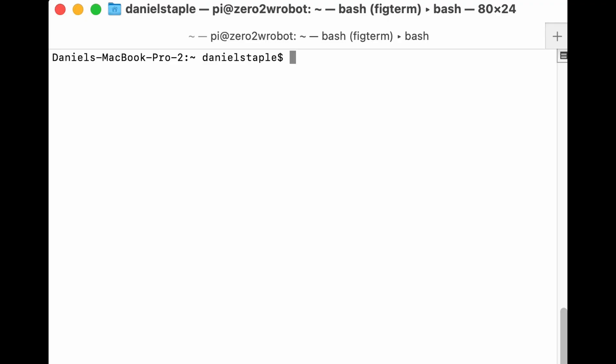You shouldn't need to do this, but I got out a tiny mini-HDMI to standard HDMI adapter, a standard HDMI cable, and a USB HDMI video capture card to see what was happening on the Pi. That was a ton of trouble — my USB capture card wasn't working well with the Pi anymore, so I ended up plugging into a real TV. After digging around, it turned out the option to transfer Wi-Fi settings from the macOS keychain didn't work. I had to manually replace the password. So if you use the Raspberry Pi Imager Wi-Fi settings, you're better off typing your password manually — the keychain password import simply didn't work.